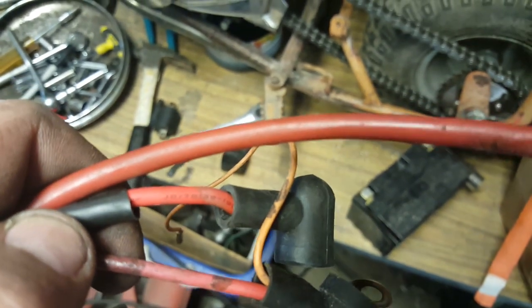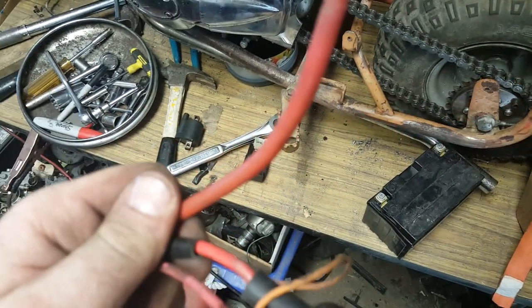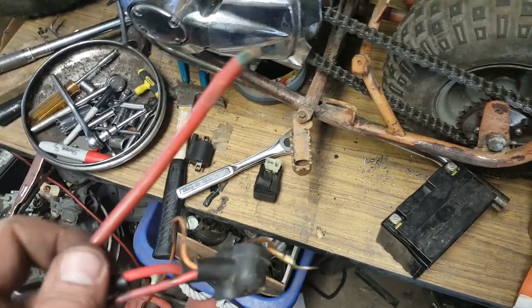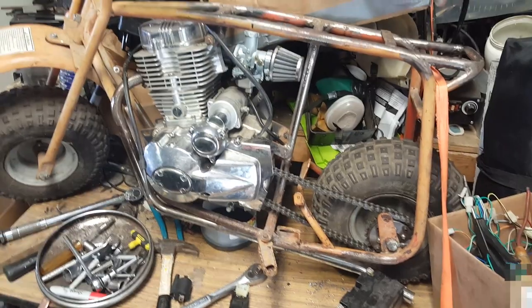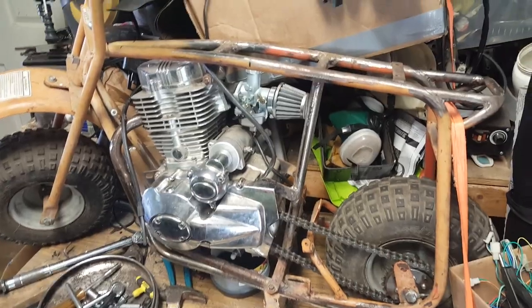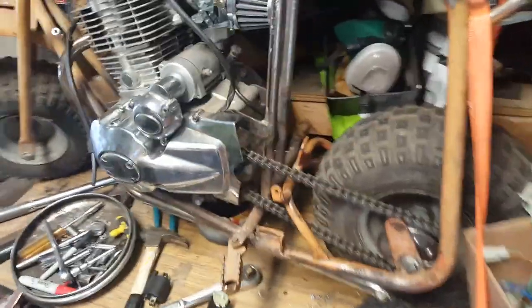I had a Suzuki wire around here I was going to show — here's a proper side-by-side comparison. The shitty little starter wires that came on this bike are on the bottom; the proper starter wire is on top. I'm going to rewire it with this big wire — much better cranking amperage to the starter motor, and it's going to be less likely to fry or overheat. That was one of the weak points on this bike: the starter sprague was a piece of crap and the kickstarter on the other side was just weak. I probably won't be using the kickstarter at all anyway because it won't clear the foot peg.